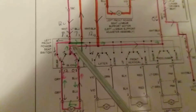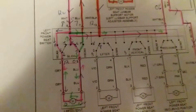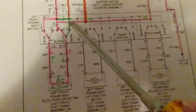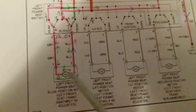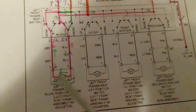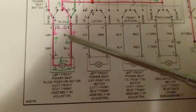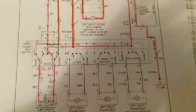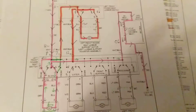As I just mentioned, the motor could go in either direction. So if you follow the red line, this will be 12 volts on this side of the motor, and the other side is connected to ground — zero volts. But what's more interesting is if you connect the other way and follow the green line, now I'm on 12 volts on this side and zero volts on the other side because I'm connected to ground. So the schematic shows this motor could be either way — it could flip-flop: 12 and zero, or zero and 12, depending on which switch you have activated. I'm going to make another video on the other ones. It's very complicated, and I hope you enjoyed it. Tune in for part two. Thank you.